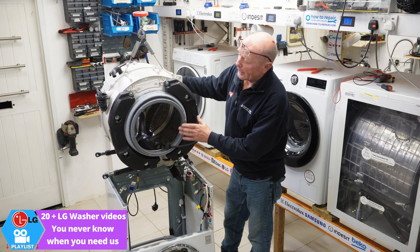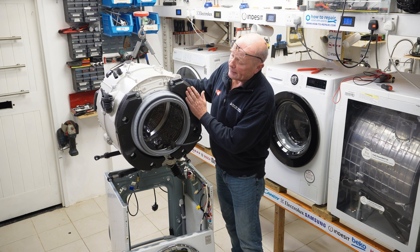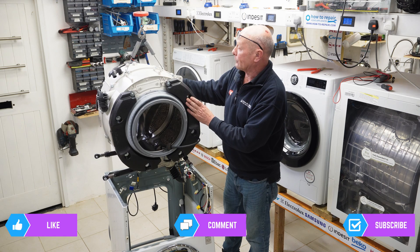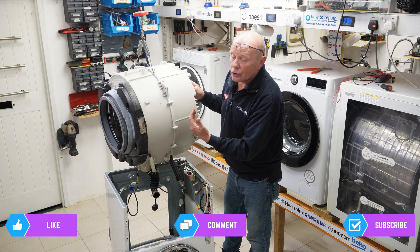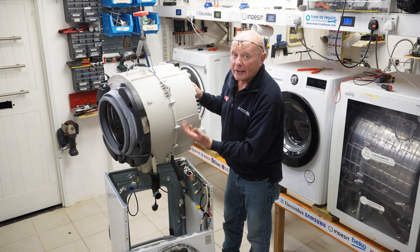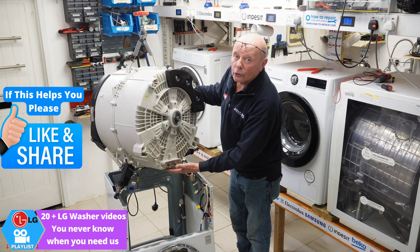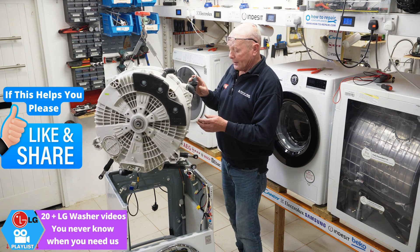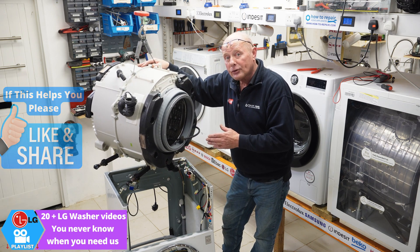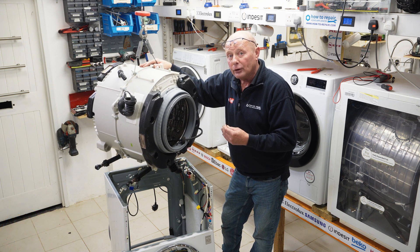In the playlist, you will find a video going up shortly with regards to changing the bearings and the spider on the machine. A couple of notes: we've got to take the counterweights off to be able to change the door seal, because the retaining band makes it impossible without removing them. The drum splits on this machine, which so many new machines do not — for the sake of 12 bolts, most drums could be separable and allow people to fit bearings. LG do a good job there. On the back of the machine you've got the heating element; on the newer machines it's at the front. You've also got the fill hose from the soapbox and the additional top hose. In the playlist you will find detailed videos on error codes, disassembly of different components, and diagnostic procedure.